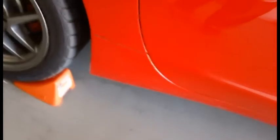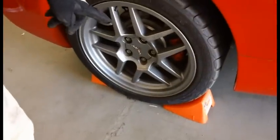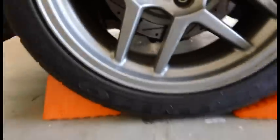When I'm changing the oil like this, you always want to make sure your rear wheels are chocked. I chuck both sides front and back — I don't kid around, because you don't want this car falling on you. It will crush you to death. This car is very low profile. Next, I leave it in gear — if you have a manual, you want to leave it in gear — and I put the parking brake on.